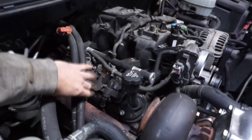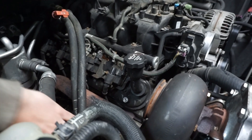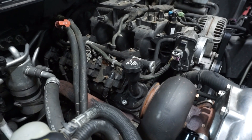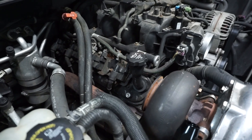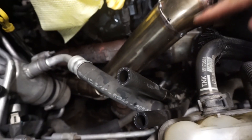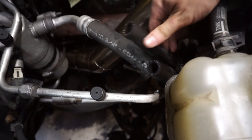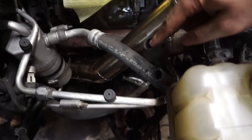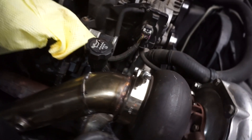The first thing I'm going to do is cut the heater hoses, then go right around where the AC line is — that should give enough room to sneak the three inches under there. I got the heater hose lines snipped and I can wrap them right around the top of that line. I started getting the downpipe welded in, just tacked into place with the MIG.